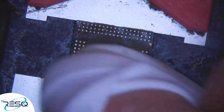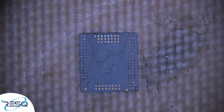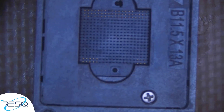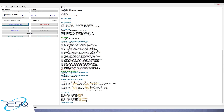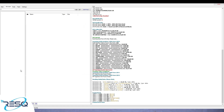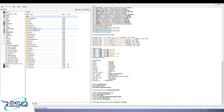After cleaning, we take it out of the holder and place it in our BGA 95 reader — the Easy JTAG BGA 95 UFS chip reader. We plug in the chip, connect to the box, and work with the eMMC file manager. Once connected, we can see that the partitions are available, including the user data partition. We open the file browser, wait for it to load, and browse through the directories.